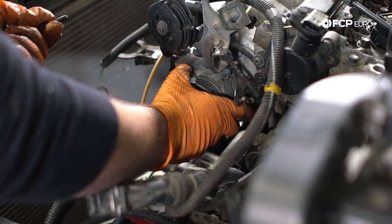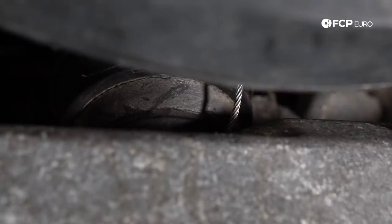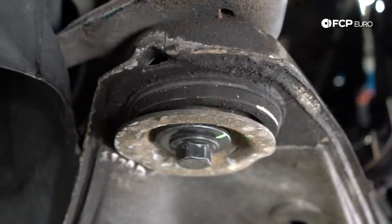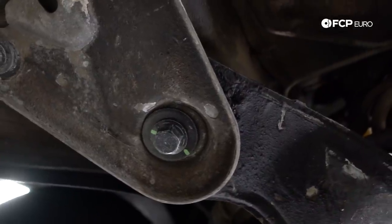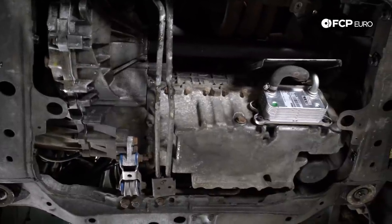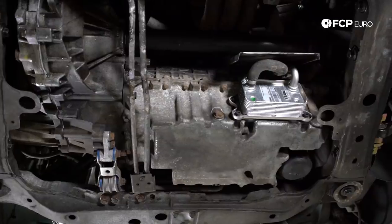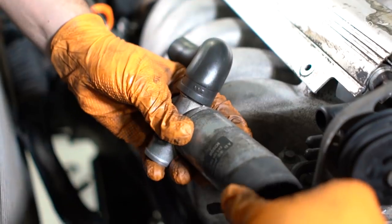The engine is in the car, and installing it was more or less the same as removing it. Using all of the 850 accessories — power steering, alternator — along with the correct forward engine mount bracket and C70 side engine mount, the new RN engine bolted in just like the old one. The difficulty was with the subframe. We're using a C70 convertible subframe which has solid inserts instead of rubber bushings. Because they have zero play, everything had to be lined up perfectly — even a millimeter off and the subframe bolts wouldn't go in. With a bit of finagling and a lot of swearing, we got everything lined up and bolted in. We did crack the fitting on our RN oil cooler, so we grabbed a new cooler off the shelf. The extra bracing on the C70 subframe will all be going back in once we cover the suspension.